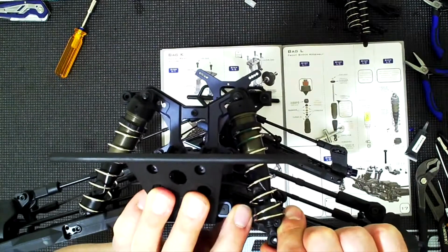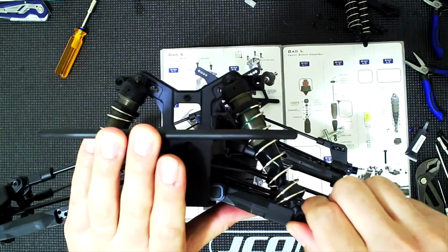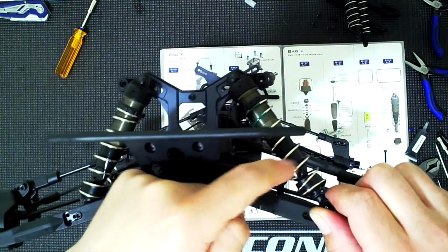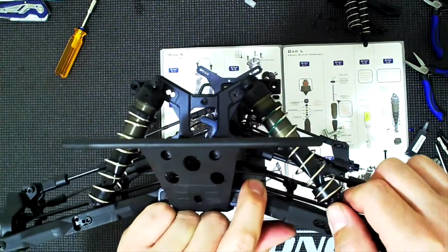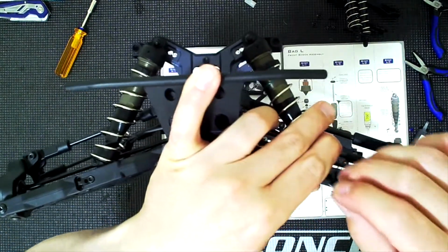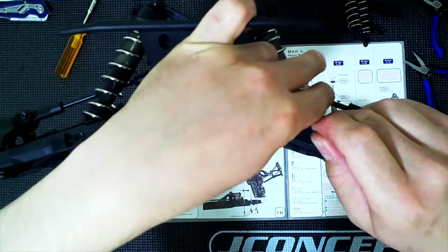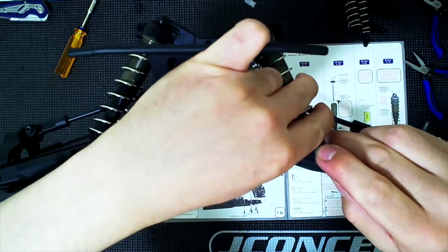So you will bend this instead of it compressing in. A shock that's like this will more than likely just compress in, and there's a lot of travel too. But the more you lay it down, you're decreasing the rate of travel. Think of how you're changing the triangle. And you're also applying more stress right where the shaft enters the body, and you can ruin a lot of the shafts on shocks. So this one, I already know my buddy will send it as high as possible. So let's go ahead and just do it this way.